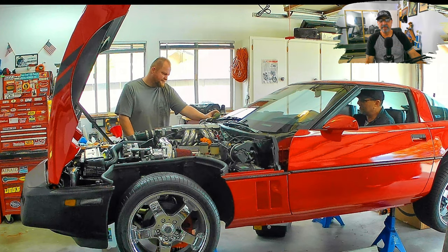What we're trying to do here is we're trying to set the base timing. Initially we'll set the timing with the car off, but we always want to come back and follow up on that with the car on. But if the Vette's not idling, it doesn't matter what you do. So let's just push on and see what happens. It's about 45 now, almost.